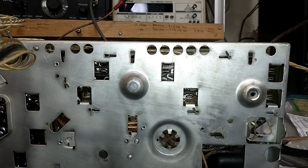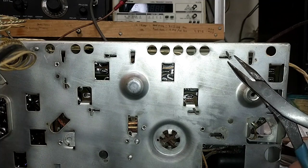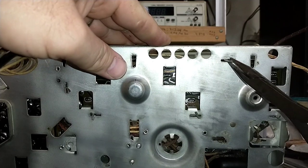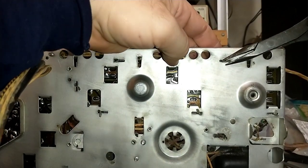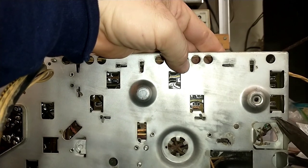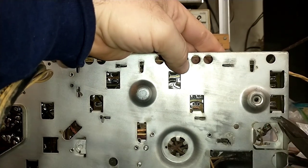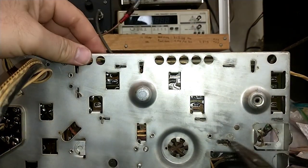I'm sure I'm gonna bump the crap out of everything so bear with me. Let me see if I can get an appropriately sized tool. Your goal is to just straighten these tabs out without bending them too much, because if you do you'll fatigue them and they'll break. We just want to get it enough so they pass through the holes and we can get the shield off.